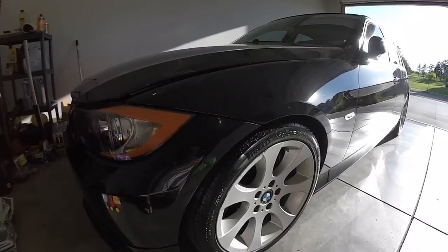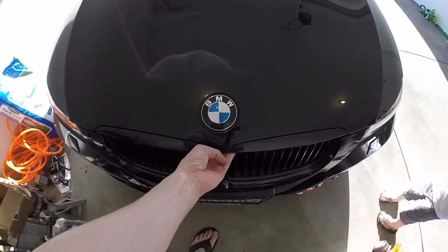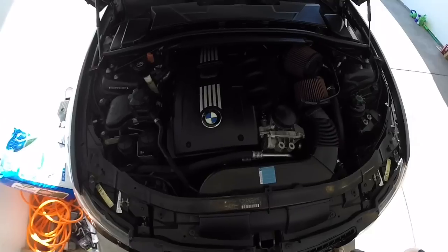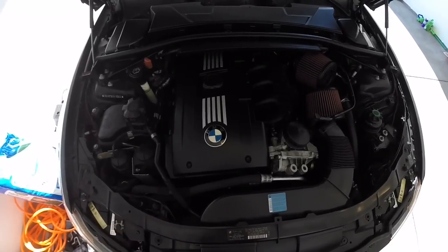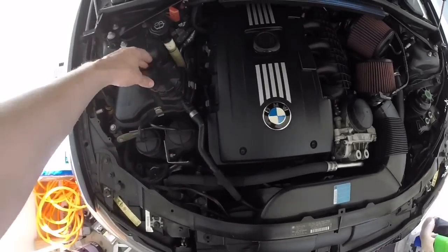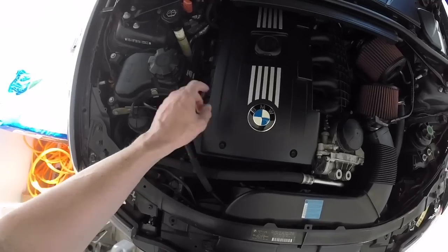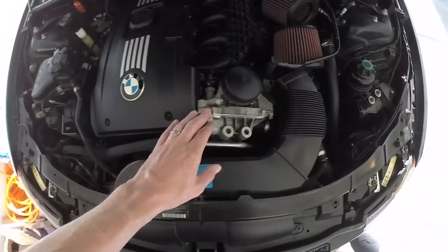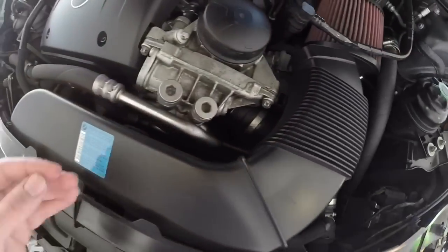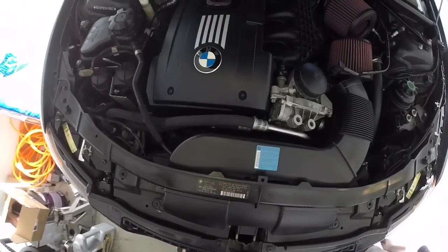Go over to the hood area and pop the hood — this is where all the magic happens with the 335i. You're going to look for engine leaks and coolant leaks. If you screw off the cap and see blue coolant, that's very important; if you do not see blue coolant, you may have oil mixing with your coolant lines through the oil filter housing gasket. Also reach down and wiggle the belt — check if it's loose or has any frays on it.